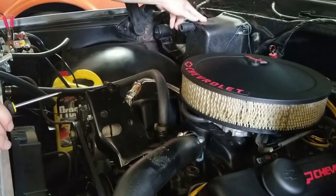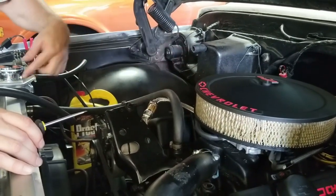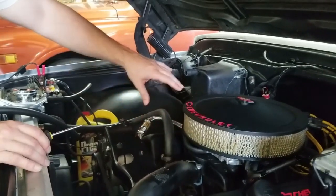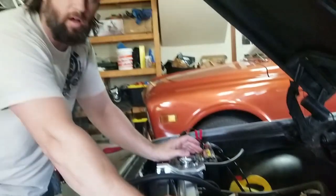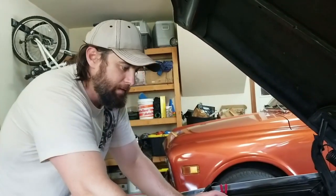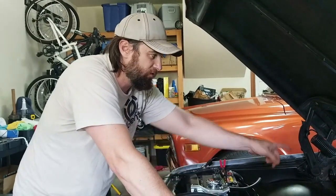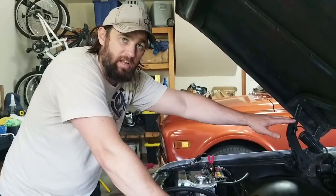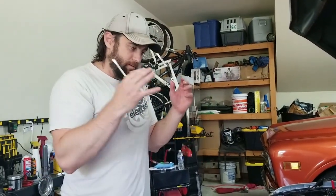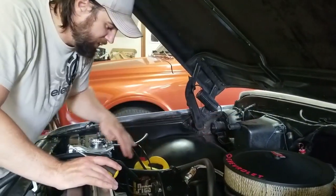Normally what you've got going on here is it runs through a mini radiator in there — a heater core — that gets hot. A fan blows through it and puts heat into the cab, then it recirculates back to the radiator which cools it down and puts it back in the motor. That's why when your heater is on and it's not fully warmed up you don't get warm heat. One trick you can do: turn your inside air fan on high and crank it all the way to heat. I know it's miserable, but it could help dissipate heat and get you home.